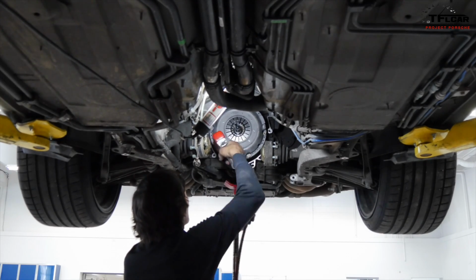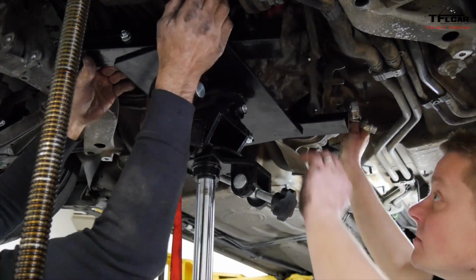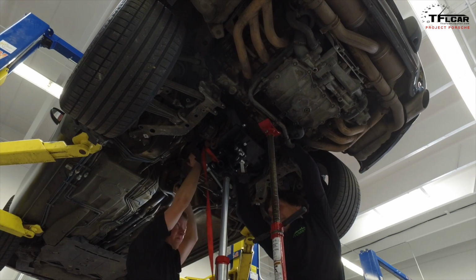How do you know when you're driving down the road and your IMS bearing lets go? Unfortunately, every now and then you'll hear a tale about somebody who heard it going or had a sense in the middle of the night that it was going, but there's really not a warning sign. There's no way to inspect it with the transmission in the car, so you just don't know. So you're driving down the road and all of a sudden your engine just loses power? Bang, done. It'll just stop running right there. And will it lock up the wheels? It can. It's unlikely because there's lots of other parts that'll give way before that happens. So you won't be fishtailing down the road? No, I don't think so.